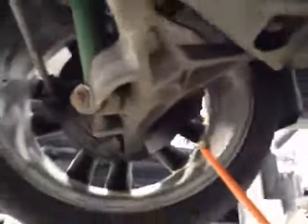Passenger rear tire is in green on the health check. Rear disc is in okay condition. Your rear brake pads are roughly about 6mm, so pads are in amber, disc is green, and tires are in green on the health check.